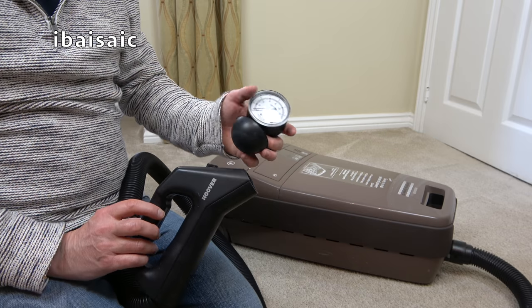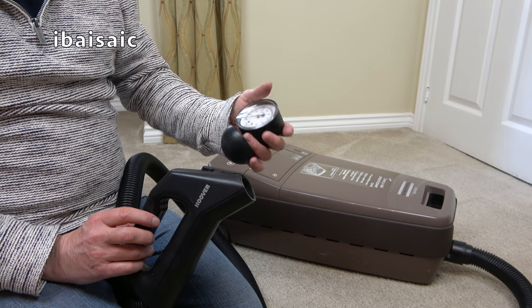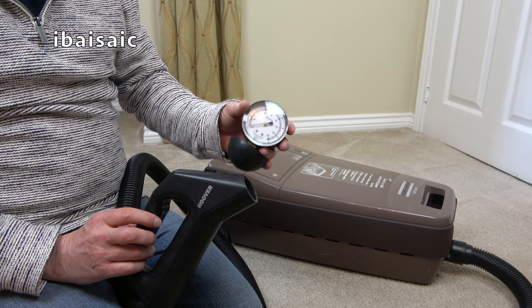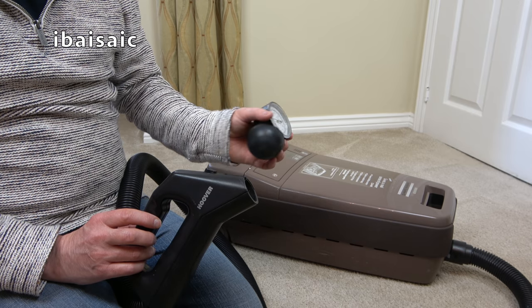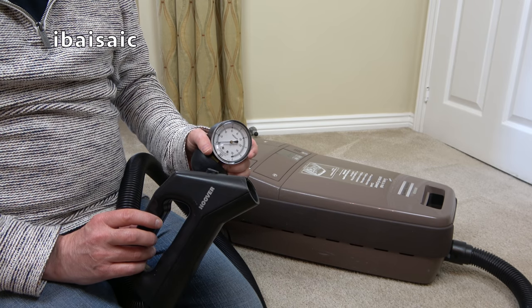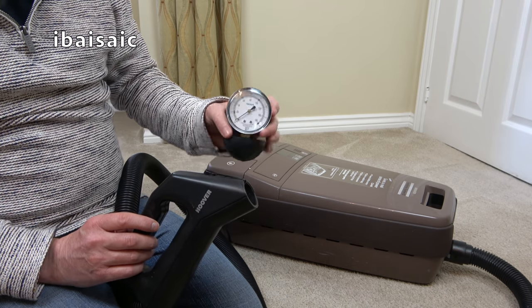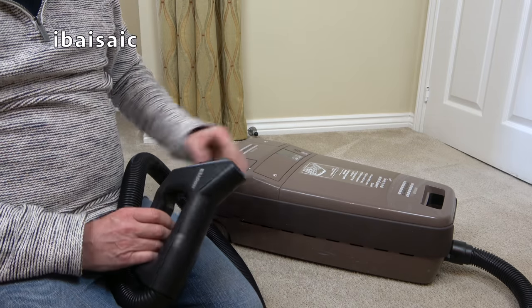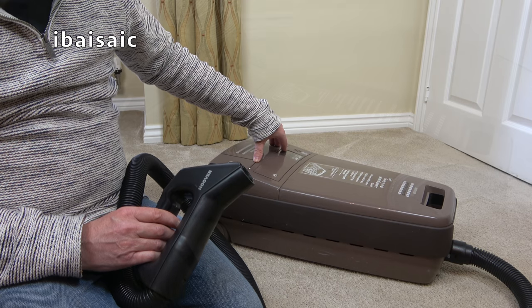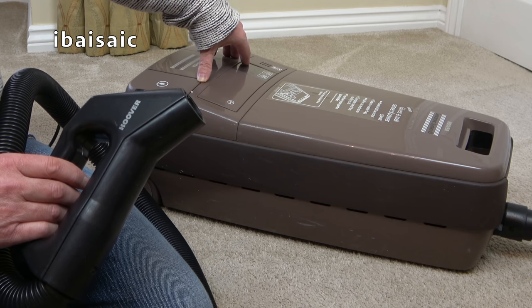Well, that was around 66 on the gauge. I think with a bit of a service and a proper seal, we might get that up to nearly 70 if we're lucky. It will have reduced in efficiency because it's an older machine, obviously. And if it had a brand new filter rather than the filter I've just vacuumed, might have added a few notches on the old suction gauge, but I didn't know what to expect with this. But it's adequate for a 900 watt vacuum cleaner from the 80s. I think most people would have been pretty satisfied with one of these.